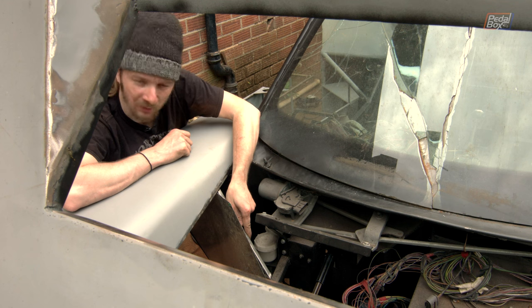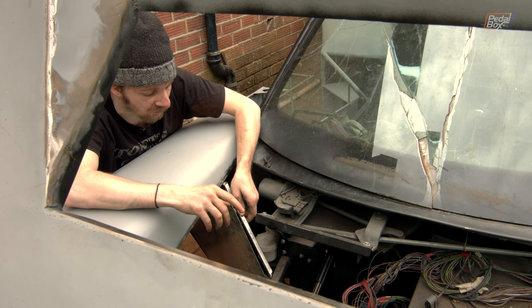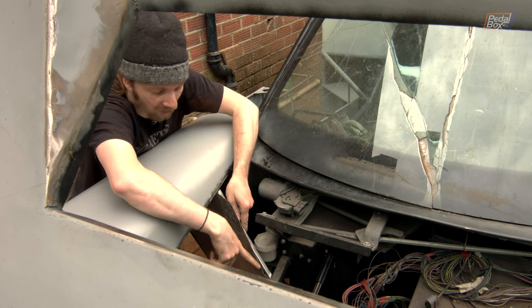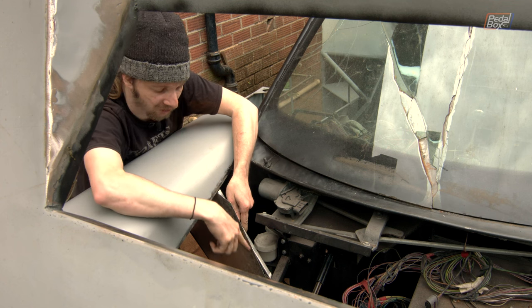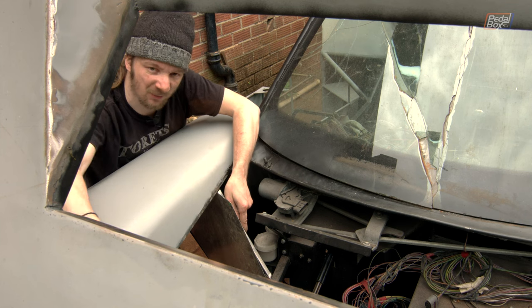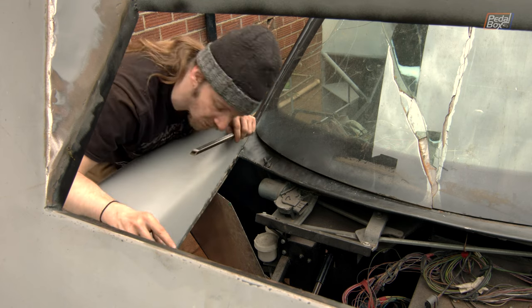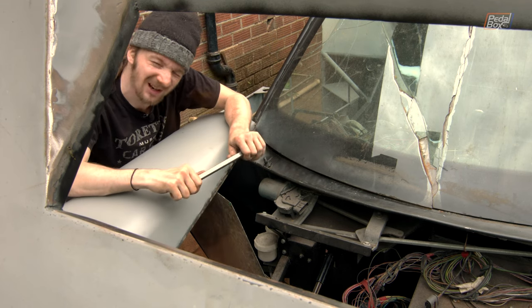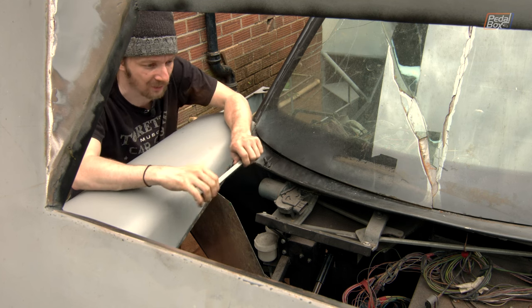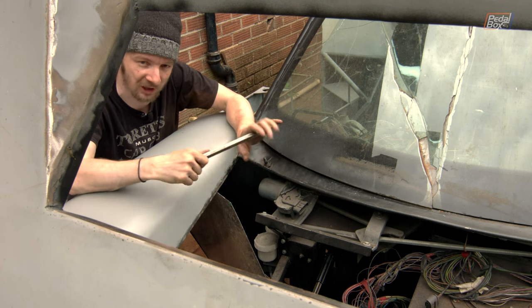While we've got all the aluminium out, we're going to do a little bit more work on our front wheel arches. We've got a new support brace to put in the back here — this is going to go from the top rail of the chassis out to our new wings. We're going to top chop all of the excess material off and put a nice big plate over the top of the wheel arches, coming up the back and across the top. Before we put the top in, we also have to put in our new drop links — we've realized the geometry is really not very good under compression, so we've made up a couple of new drop links to throw on.